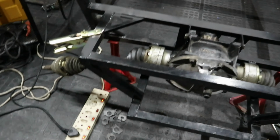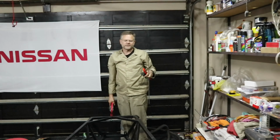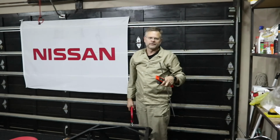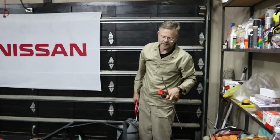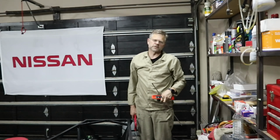I'm back again, but the axles are in, not completely fastened and everything. We still have to open the diff and put the circlips in, but that's for a later stage. The circlips go over and they just pop in. Wow, not as difficult as I thought. Don't have to open the diff. Of course, they act as seals, so you can only fill the diff with oil after they're installed permanently. But we will do that only after we're ready to put the wheels on.